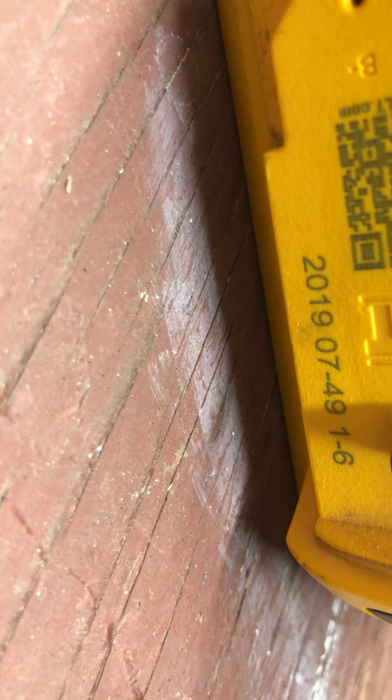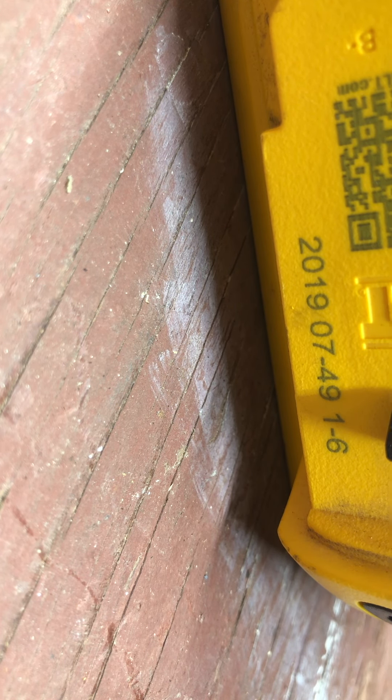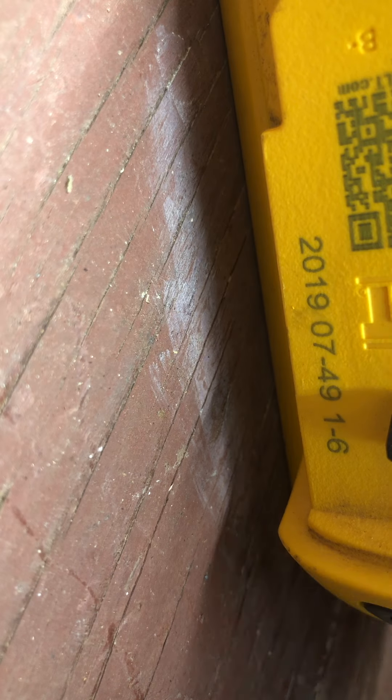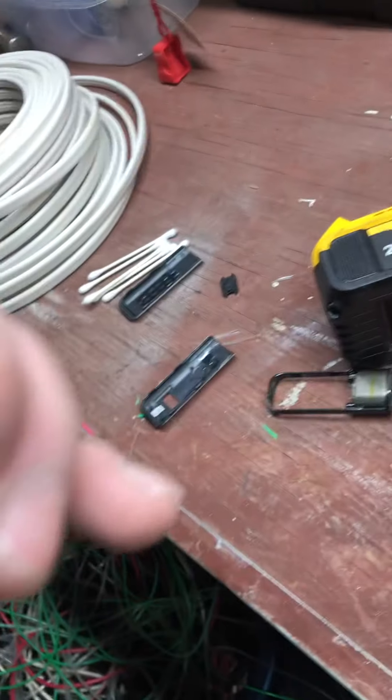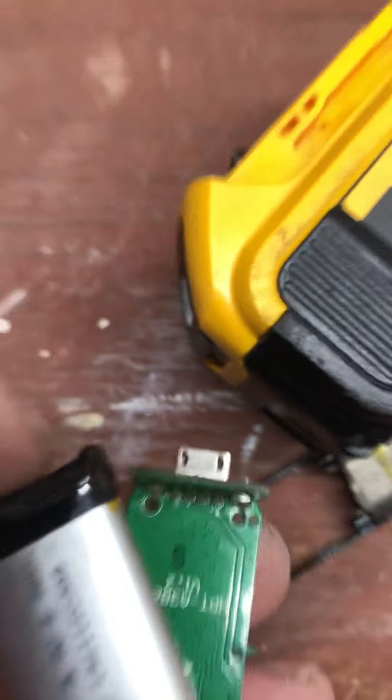It's hard with the phone. Okay, the battery's a little glued — there we go. So you lift the battery up. Those are your screw holes right there, those little small things. You undo those first.